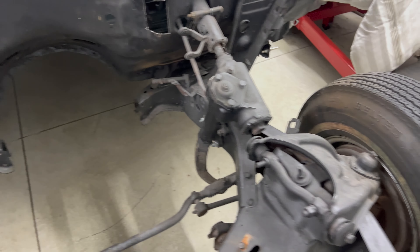So ought to be perfect when you get the ball joint spacers on it. And as you can tell from the side, they're just barely sticking out past the edges of the quarter panel — just about perfect. That also shows me that I got the rear end pretty much dead centered from side to side too. Pretty stoked on that. And here's the old trans mounts. I'd say with all this that we cut off, you probably saved just about 10 pounds. So that's well worth the hour it took to get all those off there.